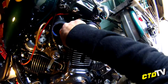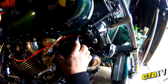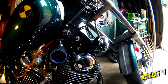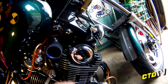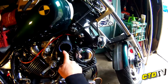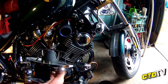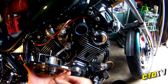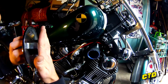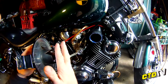Now, what it is - a little bit dirty in there, not too bad. These tubes are available for turbos, for cars - I'll put up on the screen what it is. It works perfect here - it went straight on to the standard mount. And then from that I got a section of exhaust pipe that fit on the inside. Cut the exhaust pipe into wedges like this, just to allow sideward suction. Because obviously when this is all covered over, that's where your inlet is - those fins. So you're going to have to cut some sort of access. Cut, cut, done - that's why I did it that way.